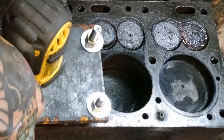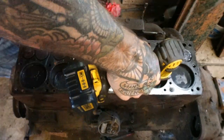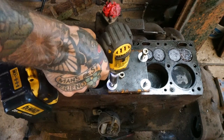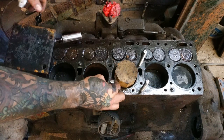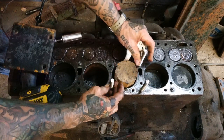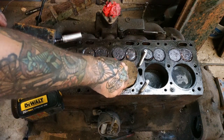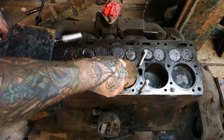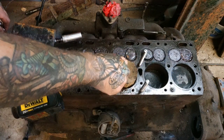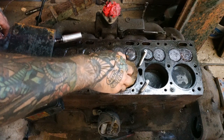There she went — she's breaking free already. Now that we've got it busted loose, this cylinder is way down on the end of its stroke, approaching bottom dead center, which we don't want to keep blasting on. So now that it's a little loose, we can move this over to another cylinder — number five — and even though we don't have four bolt holes, we can probably do it with three just to move the motor around a little bit more.